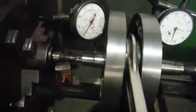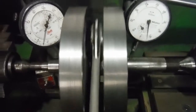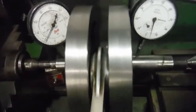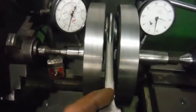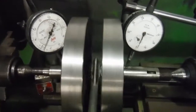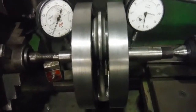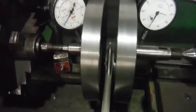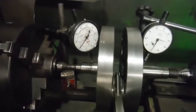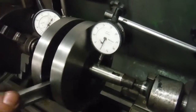Effectively, when those shafts are in the main bearings, those runouts will become zero and any slight movement will be transferred to the extreme ends of the shafts, and perhaps back to the flywheels a little. That three thousandths of an inch runout will be halved by the time it's shared between the ends of the shafts and the flywheels. So the maximum runout anywhere would be one and a half thousandths of an inch, and there'll be effectively zero runout at the main bearings. I'm very unlikely to get better than that.